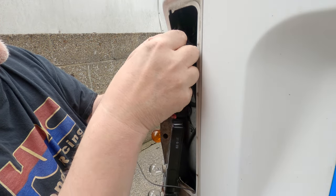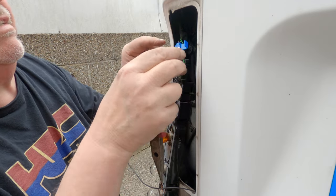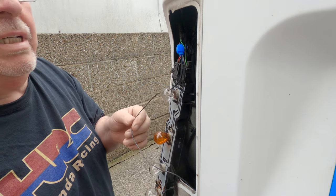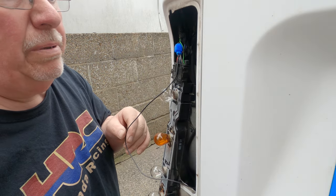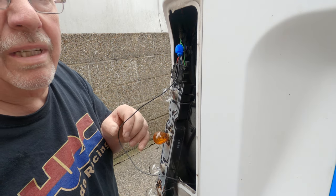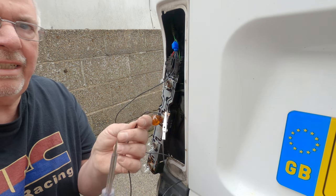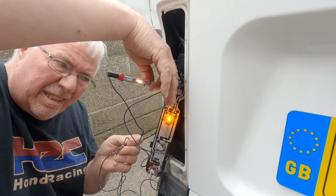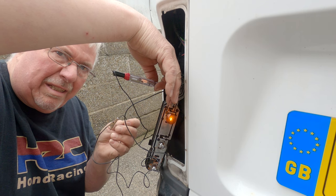Check your old wire to make sure it's not coming out at either end — looks good. What I'm going to do now is check that this wire is actually picking up the indicator when it's firing. I've put the four-way flashers on and connected a test light — yes, that shows the wire is definitely passing the indicator signal through.